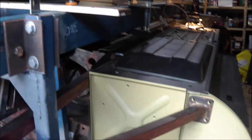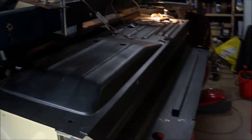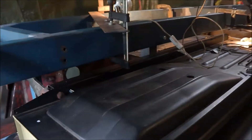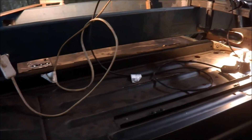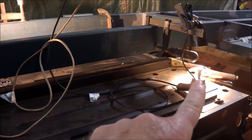I've just performed a final check of the alignment of the new panels. I wanted to do that so I can actually screw them in place, which will make it easier to do the repairs on the transmission tunnel. I've already got some patches cut for that, but I need the position of the floor. I've spent hours rechecking the alignment — I'm pretty sure it's spot on, or within a millimeter. The key points at the back and also the reaction plate area.